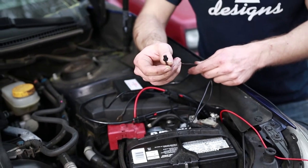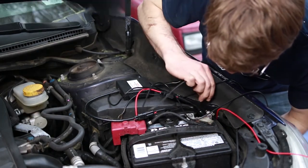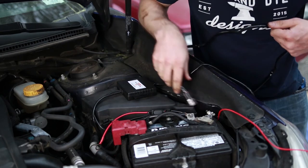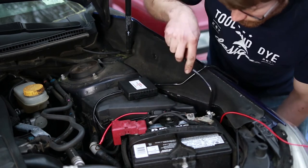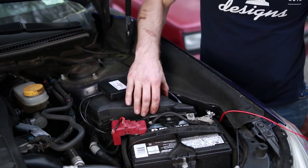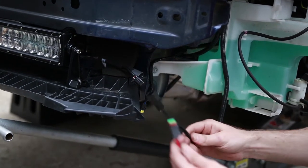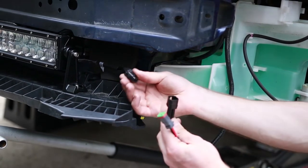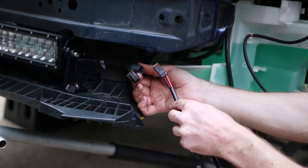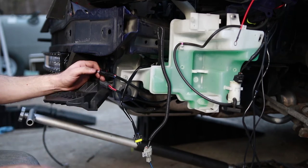We're going to feed the black connection down just where we fed the white connection — across the wheel well and in through the grommet. This other black connection is going to feed down to your light bar; go ahead and feed that down the side and up to your front light bar. Make sure you leave enough slack so that you have room to lift off your fuse box cover. So these are the two connections that plug into your light bar: the one from the RGB controller plugs into the black connector, and the gray one from power and your switch plugs into the gray connector. We connected our black and gray connectors and taped them with electrical tape to ensure no water gets in there.